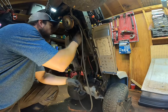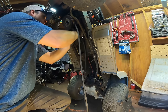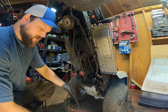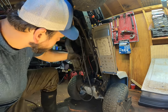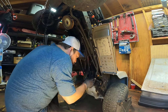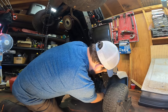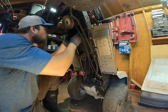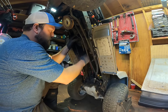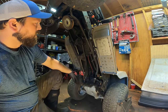All right, just looking at the belt diagram now. So this is the clutching idler. It goes around this side. Well, actually, you know what I said I was gonna do? I was gonna do the rear so I have plenty of slack. So let's try to get it on the transpo. Couldn't have gone any better. Okay, so that's on. All right, now we're on to the clutching idler. It goes around that way and there. That appears to be it.